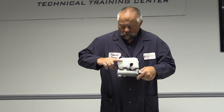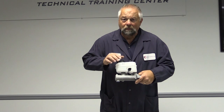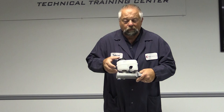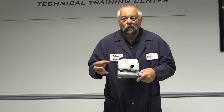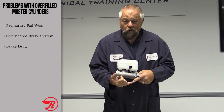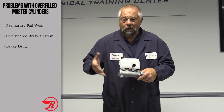If you start out with the brake fluid at the max line and you drive your car and get the brakes hot and get out and check your brake fluid, it's going to be above the max line. That's okay because it's hot brake fluid — it'll go back down when it cools down. But if you fill it all the way to the very top and you don't allow for that expansion, that hot brake fluid is going to actually start applying your brakes while you're driving. That's going to make your brake pads wear out prematurely and overheat the brakes even more, causing the whole process to accelerate quicker.